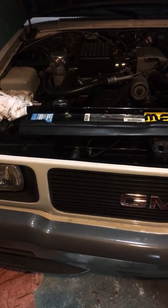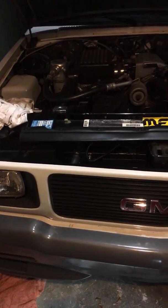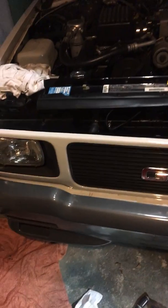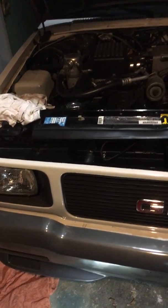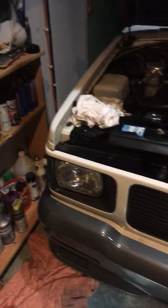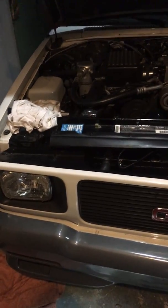There's a lot of wire that's really long with some of these kits, and I know you can cut back anything on the Alki control, any wiring you can shorten up. I know you can shorten up anything on the boost controller, I'm pretty sure, but the wideband I don't know about. I don't want it to start giving me inaccurate readings and stuff like that. And then I'm up in the air.